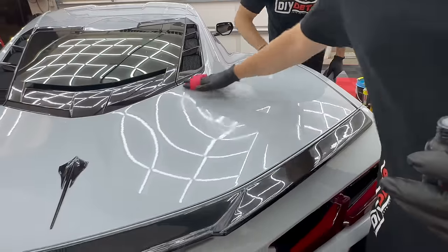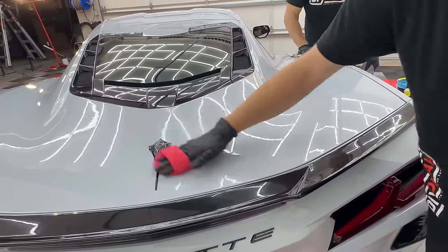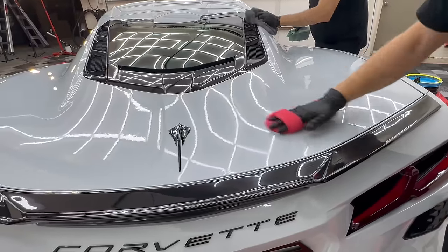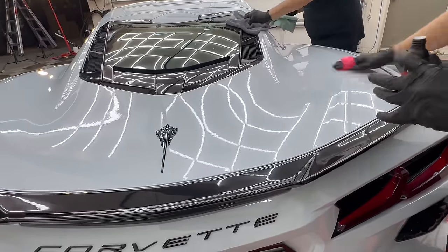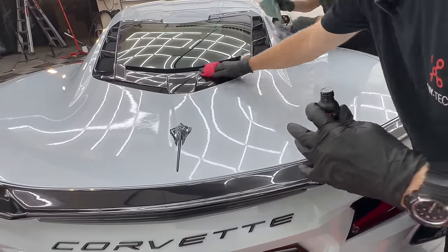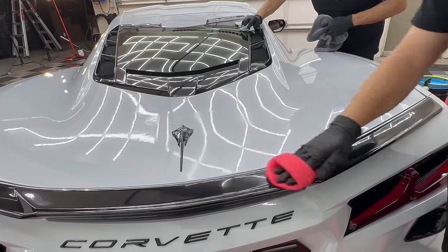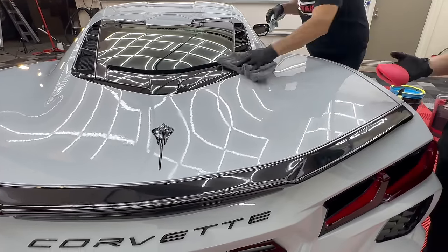The other aspect of panel prep is that ours, and other companies' as well, are engineered to work with the coating. If you were to wipe one section with IPA and another with our panel prep and then install the coating, you'd see that the section with our panel prep is actually easier to install on. It prepares the surface properly to receive the coating — the applicator glides easier and the coating levels a lot better. What if someone doesn't use panel prep? You're just compromising the longevity of the coating, and depending on the compounds and polishes you use, you may really be shortening that.